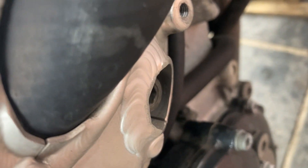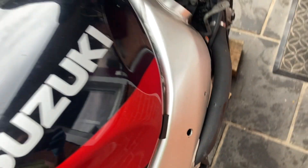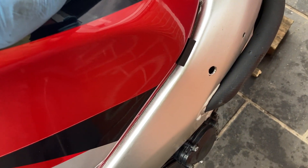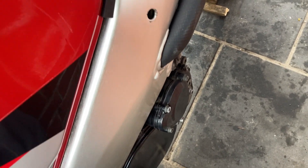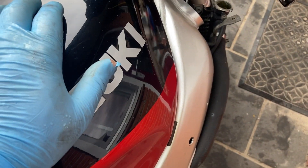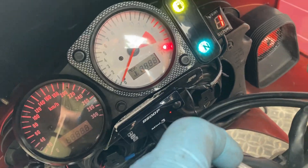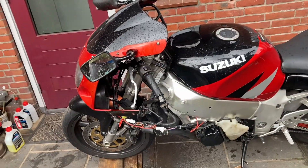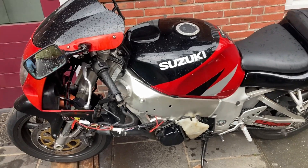The bike is on and the engine is warming up, rotating the coolant system, but I'm hearing some really weird noise. This sound is definitely not good — it sounds like the chain running loose, so that's definitely something I have to check before the bike is used again. I'm going to let her run a little on idle to make sure there's no other problem, then shut down the system. The noise is still there unfortunately, so I'm going to let her cool down and open it up to see what's going on — maybe just the tensioner, or maybe the chain has stretched out.